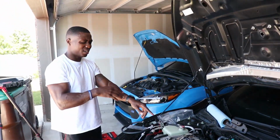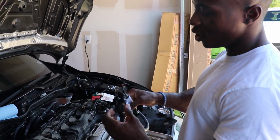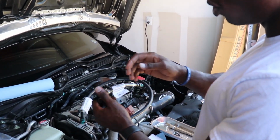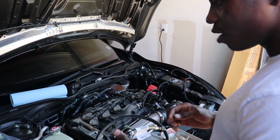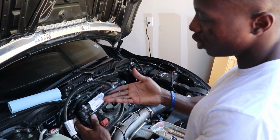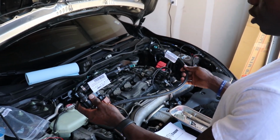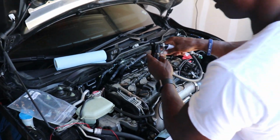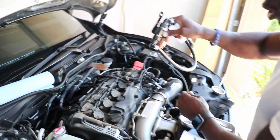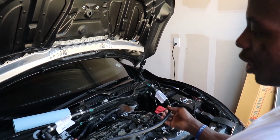Okay guys, so as soon as you're done, I would highly recommend attaching the fuel analyzer to the bracket first. That gives you an idea of which portion is up and which one is down. It comes with some red covers on here. You take those covers off, and the top portion is the shorter fuel line, as you can see, and the bottom portion is the longer fuel line, and it basically goes on here like this. We'd have to play around with this and make sure the wires are not in the way, but this is essentially the entire connection.